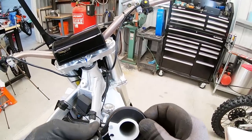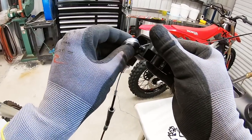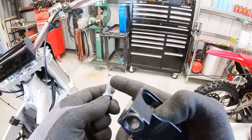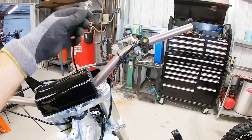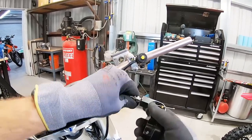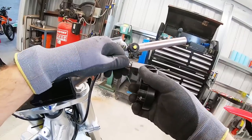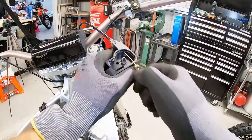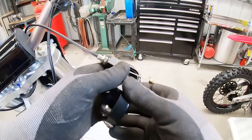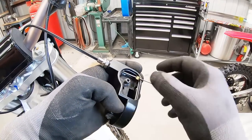There is where the magic happens. The wheel is a little bit of a pain to get out — in that regard I like the traditional throttle assembly a little better. Wheel is out, and now we can unthread this whole doodad here. Hopefully the Electron cable is the same thread pitch — we did the best we could over email. Go ahead and slide the new cable through and let's see if it's the same. Yup — killed it, perfect. This is just like all the other Electrons. Make sure the little ball end comes out, as it could have easily been left behind in the threaded area.